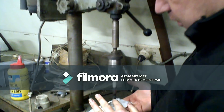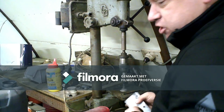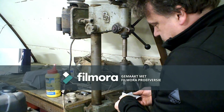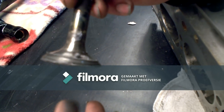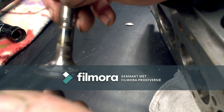So I clean it up. You always have to watch out that you don't clean the line where it's fitting, because then you can change the angle where it's closing. If the line keeps going without any interruption, then you know the valve is ready to go back in.